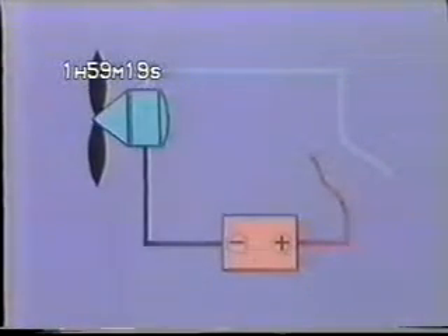Checking the fan motor is a simple matter of connecting a 12-volt battery directly to the motor leads. If the fan operates smoothly and with no abnormal vibration, it can be considered in good condition.